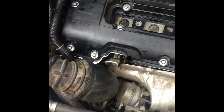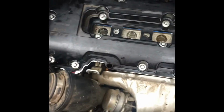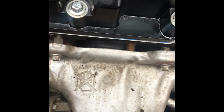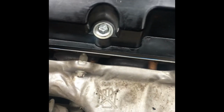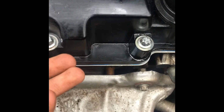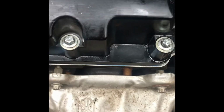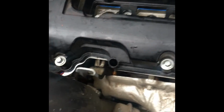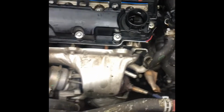I got these all tightened down. And I was just thinking where the O-rings might go is right under the bolt head. I think it's unlikely though, because it's such a tight seal anyway. I could not imagine oil being able to run all its way up and then get out of there to a point where it would cause a leak. So you can see there's a little bit of oil right there, but that's just from the bolt. We had this manifold over, so all the oil that was on it was running in the holes. Don't think that's any bad news, but just clean it off.